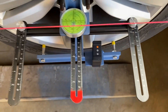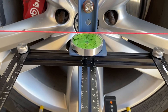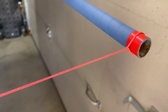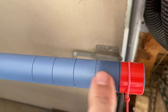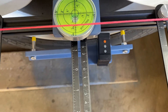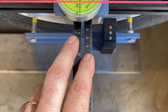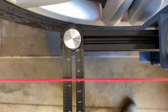I try to get it as close as I can. Same thing — a bullseye — just to get me in the ballpark, then the framework. I happen to have a tow bar at the back and I clamp that on there. It's just a normal bit of string at the end with graduations every 10 millimeters to give an indication of how far to go in. The more critical thing is to get the string directly above so that it's parallel to each side — left or right — and then I can figure out where my toe-in is.